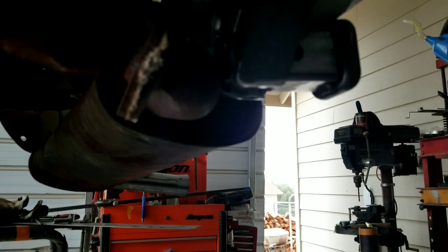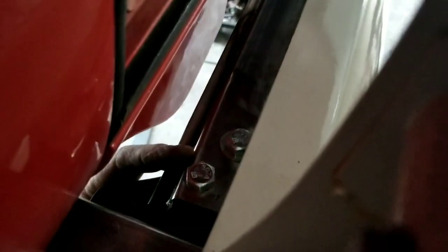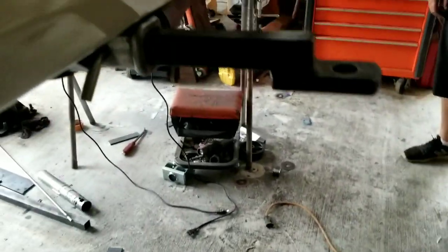It's a pretty well hideaway hitch system - it's not noticeable at all. You could still bolt the mud trays in the back if you wanted to. You'll probably have to put a nut-cert in here since it's a nut and bolt, and they overlap a little bit. But once the bolt section is in there you'll probably never take this off. If you're going to pull the engine and want to pull the bumper off, you just take those four bolts off and pull the whole section - that'll pull the hitch and everything off.